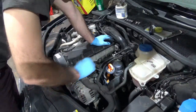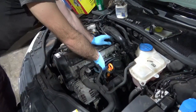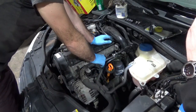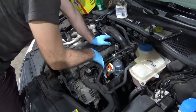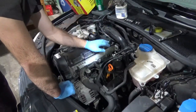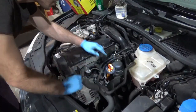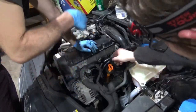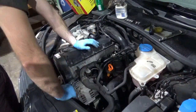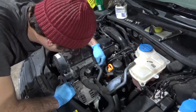But also, what we'd do is get a teapot and soak the end of it in boiling water. Or boiling soapy water would kill two birds with one stone. Then you get it all soft and you can push it on, because it has to go over a bead. If you try to do it cold, it's a real pain, and you can tap on it, stuff it up, crack them. So I'd always put them in a little jar of water that was just off the boil. But yeah, okay, let's work on the harness.